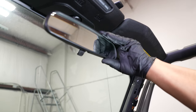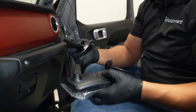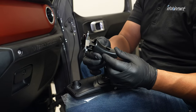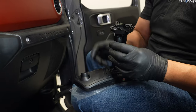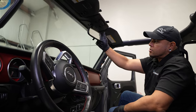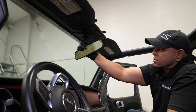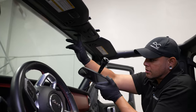From here, we'll take off the rearview mirror and replace it with the one included with the kit. Your kit will include two different brackets depending on your application. We have a JL body style Jeep, so we're going to use this bracket here, which looks like a very big tripod. This is going to replace the factory bracket once we remove that mirror. To remove the mirror, you basically just want to grab the base of the mirror and spin it towards the steering wheel, and it'll spin right out of that mount.